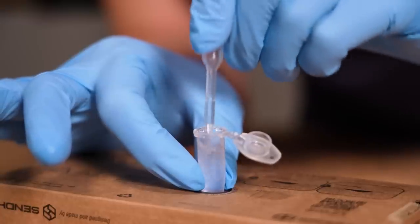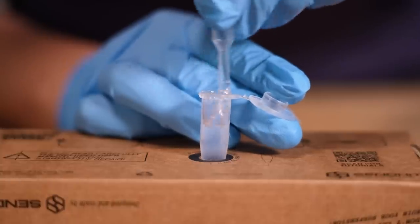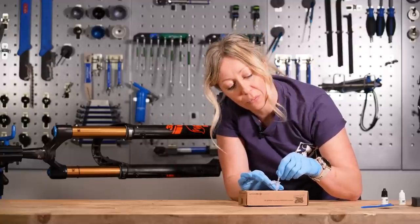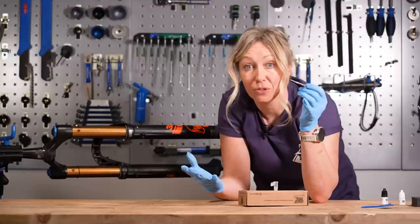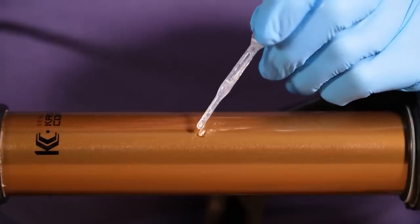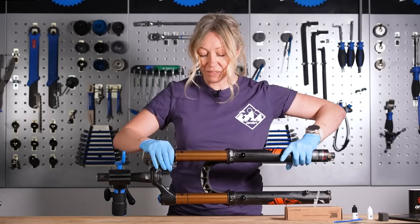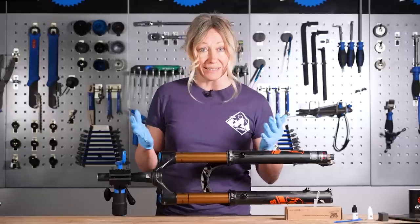You can see there are air bubbles in there — three minutes of stirring is to make sure there are no air bubbles whatsoever, and you might have to change direction and use some different actions to get those bubbles to come out. Three minutes later that's looking pretty smooth and all the big bubbles are gone, so we've got a nice amount of resin in our pipette. I'm applying the resin as minimally as possible — you don't want a big patch of it because you don't want to be sanding away a big patch later. Let that set with the scratch facing upwards so it doesn't dribble out, and leave it for about six to eight hours.